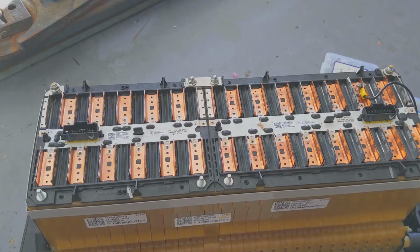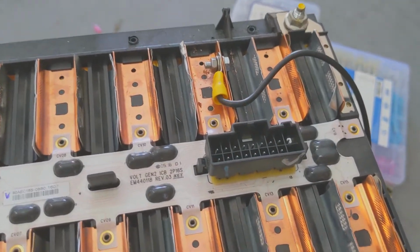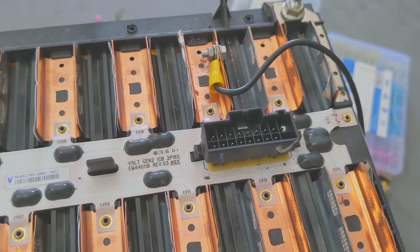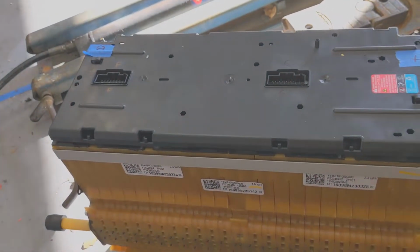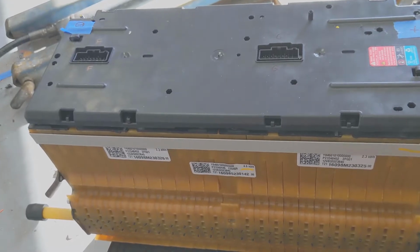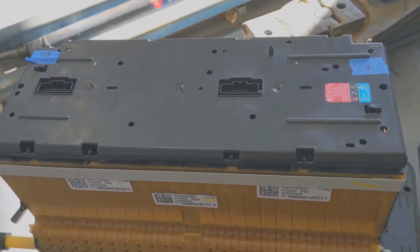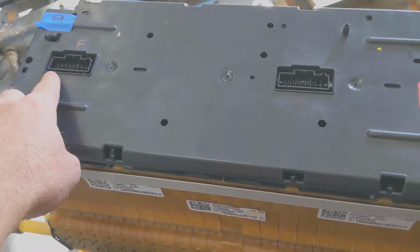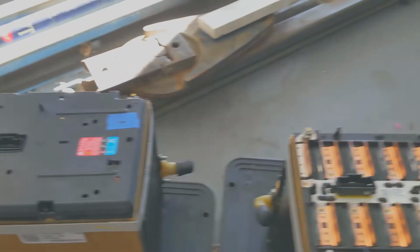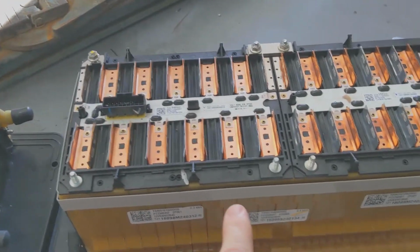Okay, so here is the last thing that it took me a while to understand, and that is the necessity for this cell tap right here. Let me explain. These batteries are all going to be wired together, and the wire loom that connects these is actually super simple because we have 12 cells, and then 12 cells. That's exactly how the Orion BMS is designed, so it's really just one-to-one wiring. You'll see there's exactly 12 leads in here plus the negative, 12 leads here plus the negative, and on this one, 12 leads here plus the negative. So wiring these 3 groups of 12 is very natural.